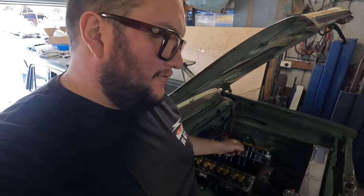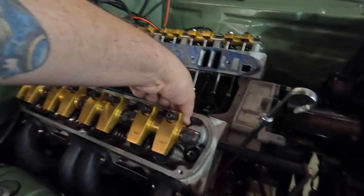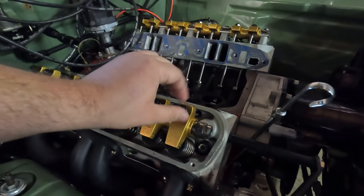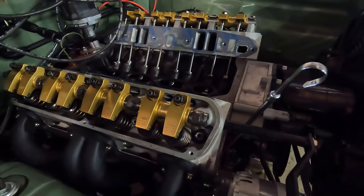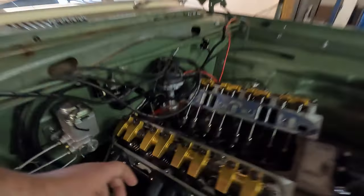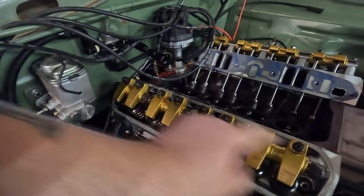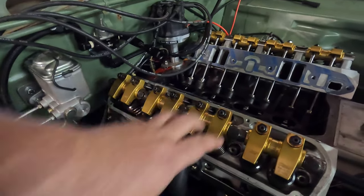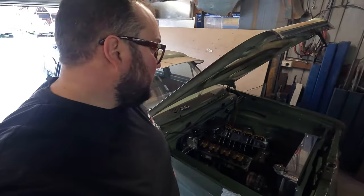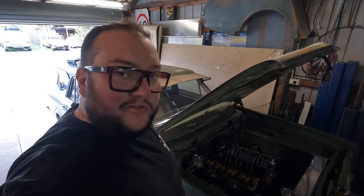What I've actually done is loosened the roller rockers off so the screws are right out, just so there's no tension — the cam's obviously in place. We'll start to screw those back in once we get everything set down, then start to adjust valves. With Mopars they're on a shaft, so we're going to start in the center and work out, trying to keep even tension all the way on the shaft as we bring it down tight, torque it up, and set some adjustment.